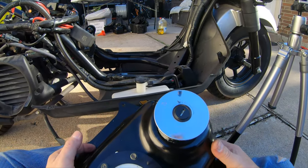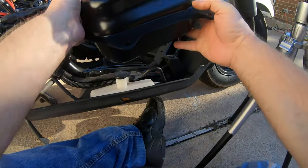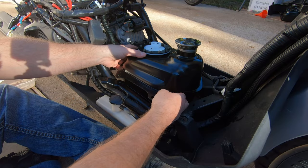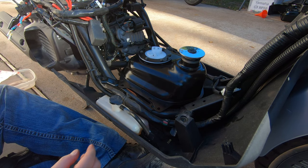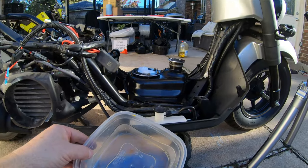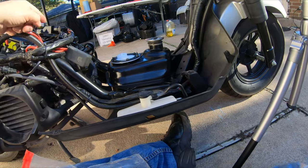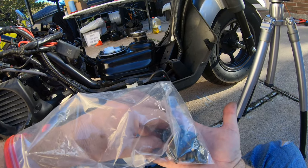Okay, let's get this tank back in there and get everything hooked up to it and hope everything fires up. I did have to take that fuel line off because I just wasn't getting enough reach to really clean it out, and it came out pretty gnarly — it was nasty. I flushed it out a couple of times. You can't really disassemble the fuel injector from the hose without messing with that metal clamp, and that's a really bad idea because it's a high-pressure clamp.